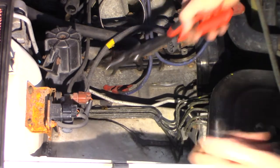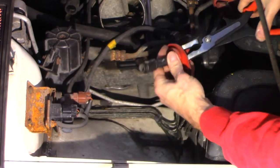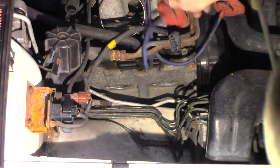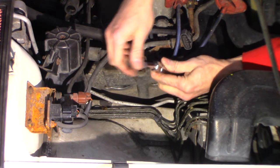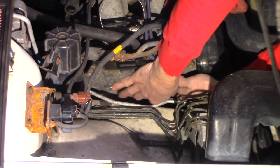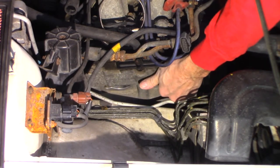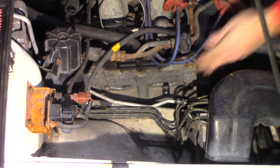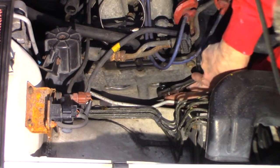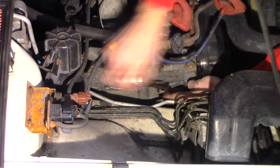This might be easy — yeah, right out of there. Let's put it up out of the way. I don't know if that's the tracking on there or just me pulling it out, but alright. So I've got a wobble extension and a five-eighths socket. I have a special spark plug socket but it's the wrong size for what I need, so it's not going to help me. Just feed that over there, sneak down in there, get started here — there we go.